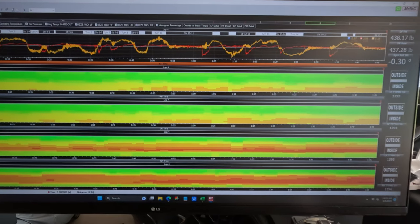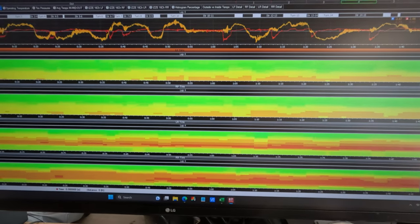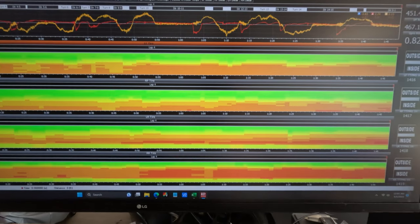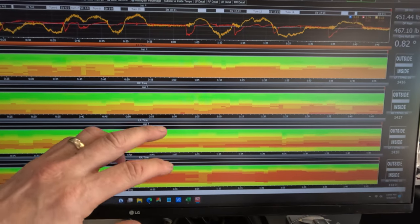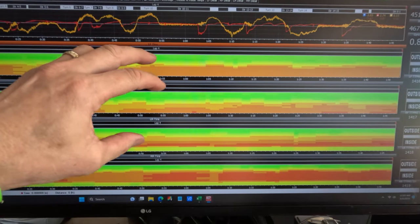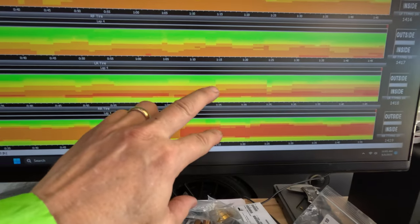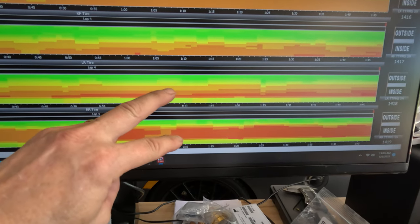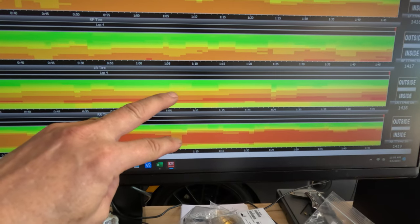Now let me just click on our last run here, just an hour or so ago. So watch this when I click. Here's the new one. Look at that. So we took out negative camber. We're trying to move the heat more center tire and across the tire effectively. The rears look pretty good, possibly a touch more positive camber, a tenth or so of a degree.